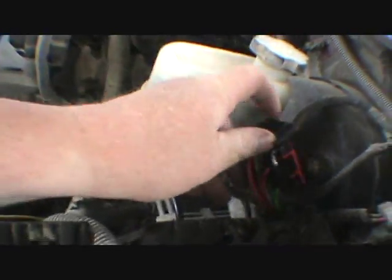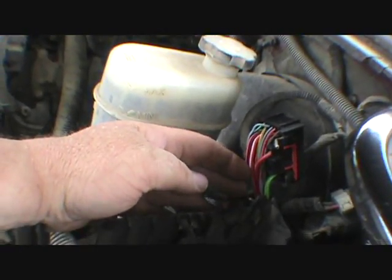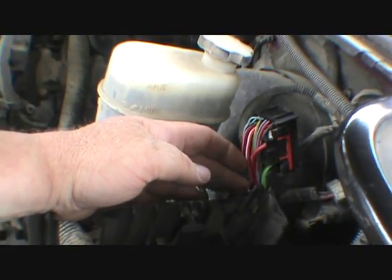Well, we're working on the Denali. Tank's down. And okay, we're going back to the factory wiring and harness for at least one side of the wire, because I wasn't happy with that wire they added. Well, I got it undone up here, getting ready to repair the wire that they cut up here, because I used the ohm meter and tested it. That wire is good. It zeroes out. Why somebody added this other wire, we don't know.